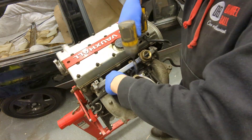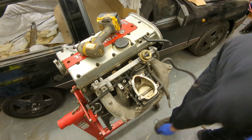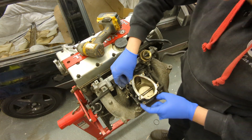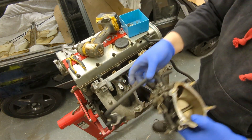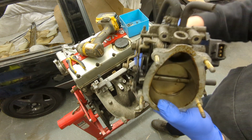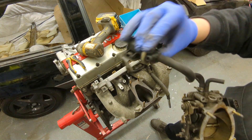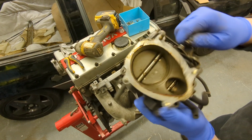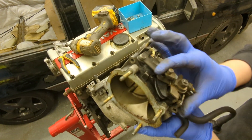Throttle body — four M6 10-mil nuts. They should have the built-in washer but they don't, these aren't original. The breather part there is very split. On an overrun version we don't actually use these so I'll just cap it. Throttle body itself is functioning nicely — not sticking, no excessive play in the linkage.